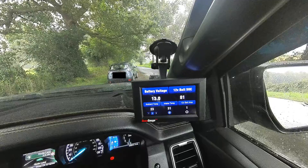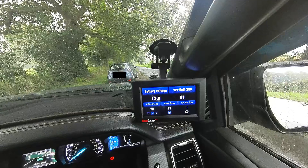The battery voltage goes as high as 14.5 depending on how the battery is. Both of those readings plus the amps are an indication of the alternator and whether it's actually working — yes, it either works or it doesn't, but it's an early heads up of what's going on.